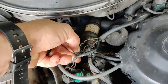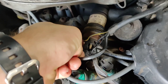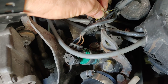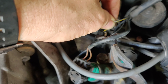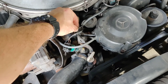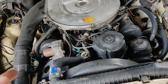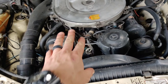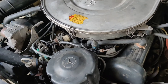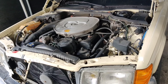...and try to connect this side of it to where it goes, which will allow me to get this connection to work. Okay, you can see now the idle went completely down. So now I know it's definitely due to that switch. Now what I want to do is rewire that switch and clean those connectors — I think the connectors are very dirty as well, as a lot of oil and stuff does get up in this area.